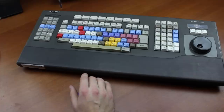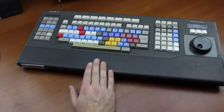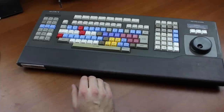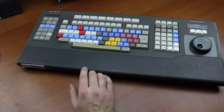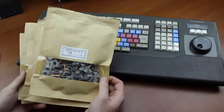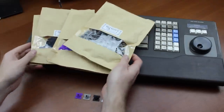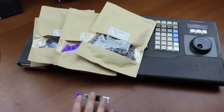One reason I might have gotten it cheaply is that this is the Omron model, while the BKE series is more well known for coming with a unique non-capacitive version of Topre switches. Those are based on conductive domes and are said to be far snappier than stock Topre switches. This even led to the development of aftermarket single Topre domes you could put in your Topre keyboard to enhance tactility — the snappiness is similar to BTC dome-and-slider. They come in four weightings: light, stiff, ridiculous, and just plain silly.